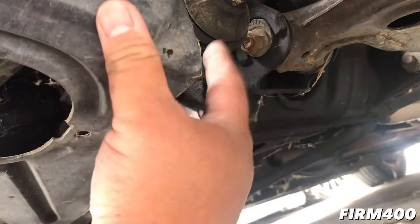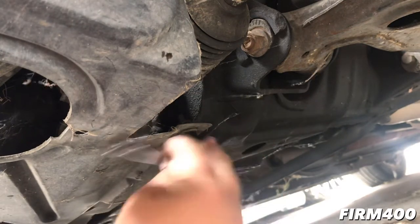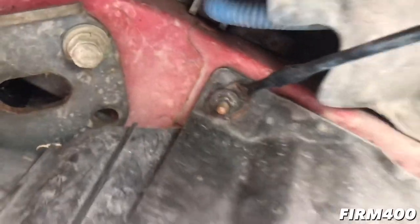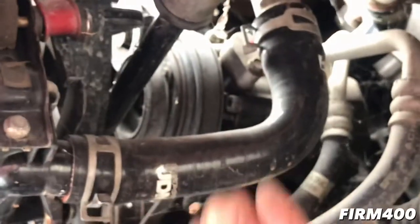So I'm going to be removing the bolts holding the bottom engine cover — you're going to need a 10mm to remove it. There's a bolt right here and another bolt over there. That whole cover is going to come off, exposing the area where the radiator is. You need to remove a 10mm center bolt right here holding the other bolts.